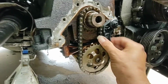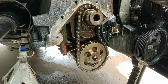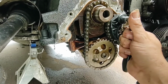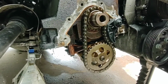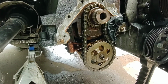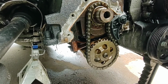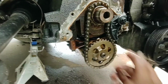Okay. So that's got a little bit of give. All right, so that right there, I recommend looking up the torque spec for it, but I felt it coming apart, and I feel like I've kind of got it back where it wants to be, so I'm okay with it. But basically, I put it snug to where it was just under hand tight, and then I did hand tight plus a solid quarter turn plus an eighth of a turn. So that should be good.